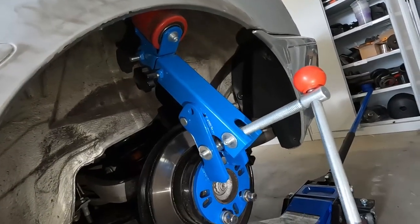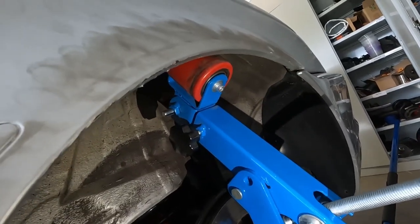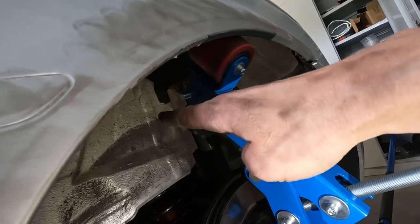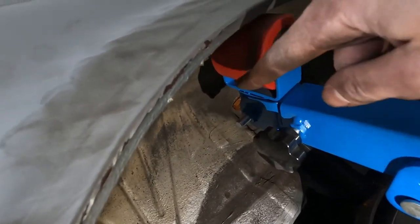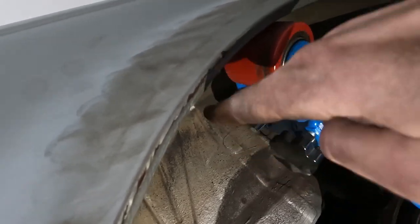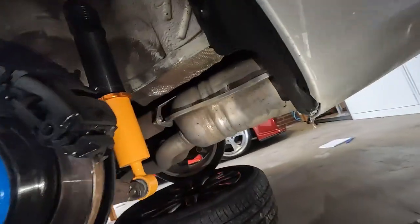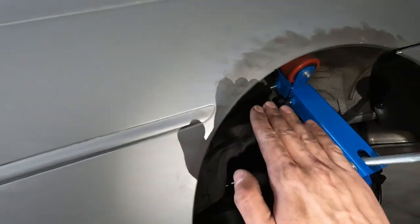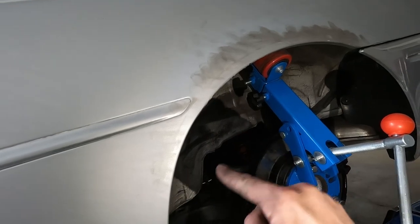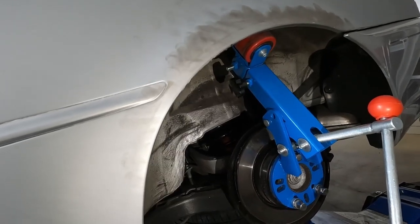Here's your actual rolling device. Now, as you can see, the wheel kind of makes it, which is all good. But I don't actually want to just do that angle. What I'd like to do is more of this angle, because see how it's quite flat? I want to angle it that way to push it up a bit more instead of just smushing it inwards - we want to roll it up. So I'm going to come down here, take that fold out, and drop the whole hub assembly down a little bit so I can drop this whole mechanism down, angle that wheel more that way, and then gradually turn it in as I go up. I'm going to catch you guys on a time-lapse and we're going to hit this.